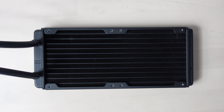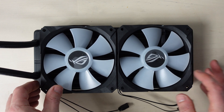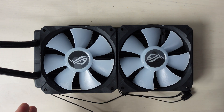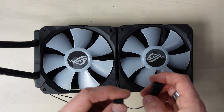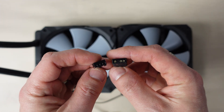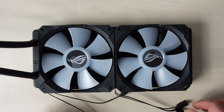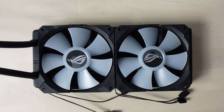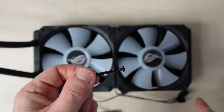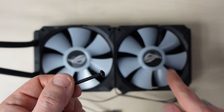Now it is time to get these fans on. I'm thinking of having them like that, which is the way that you should do it, but I'm also thinking about the cables — I've got the cables sat at the back because they will go through my cable management holes. The fans have got two connectors: the standard fan connector and the addressable 5-volt RGB connector. I'm going to arrange them so the cable management goes into the back and there aren't cables everywhere. You fix them onto the radiator with these very long screws — no washers needed, just the screw. I'm going to get all eight screws in and remember to work in a crisscross fashion.